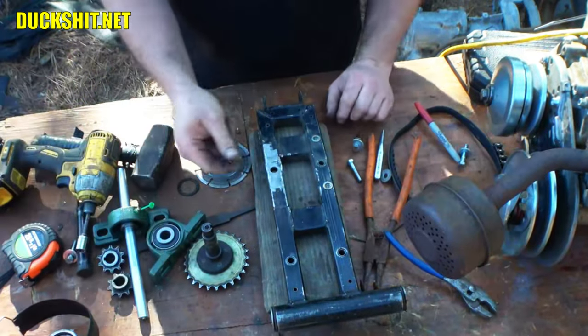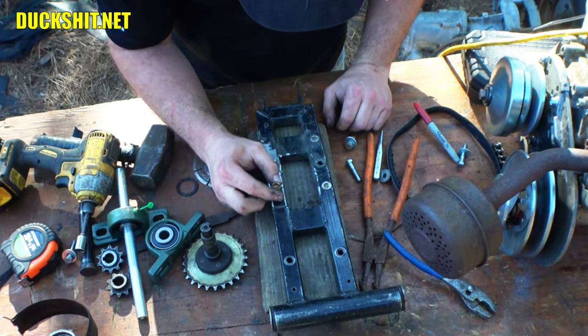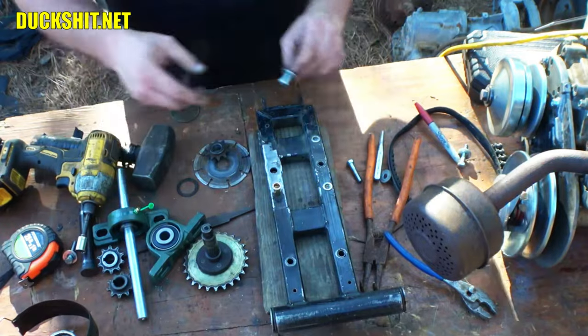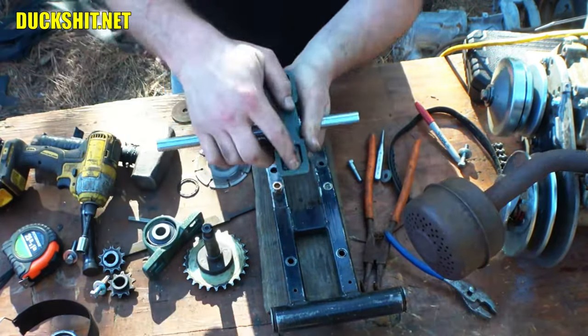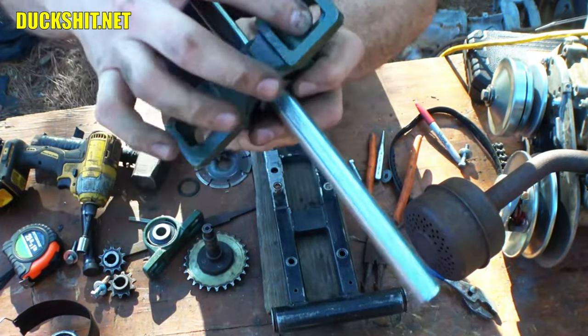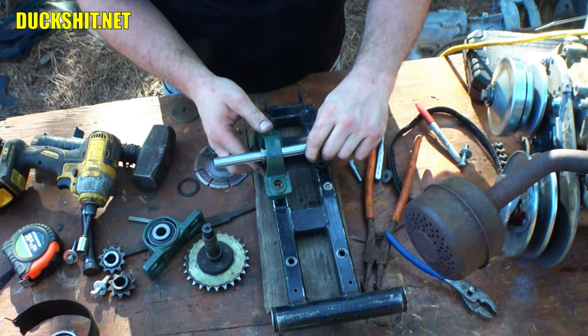Out them holes, and then we'll come back and we'll install a couple of riv nuts here. Yeah, it should go right in there. I'm putting these two a little closer together than I did on the other two because I noticed when I put the riv nuts on the inside of these, and these have a little indentation, it's a little recessed, the riv nuts fit better when they're a little closer together.